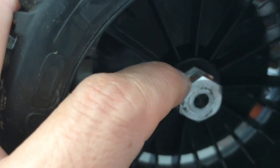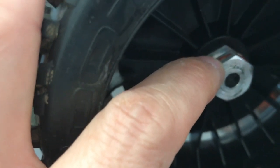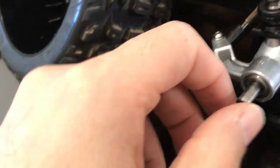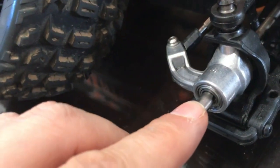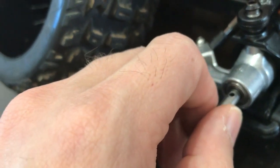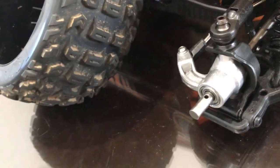I've seen this done with wheels before, and I'm going to do it in there to keep that pin in place. Normally this does not happen, but there was excessive shaking of the wheel due to the fact that this drive shaft is bent. As it bends, the wheel wobbles and shakes, and this truck is just so powerful that it makes it shake even more.